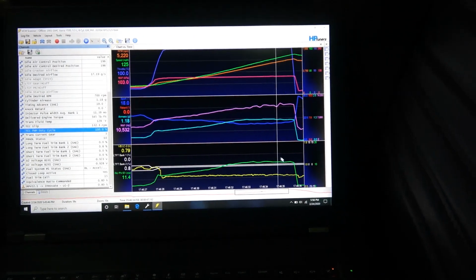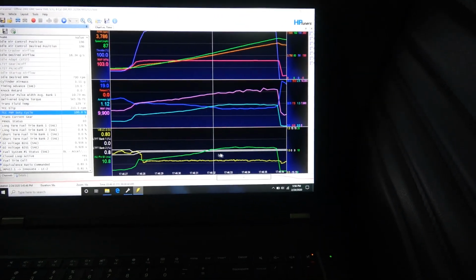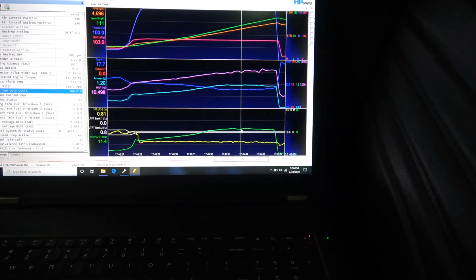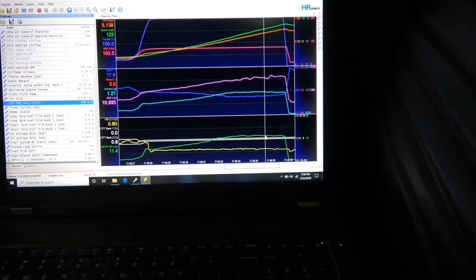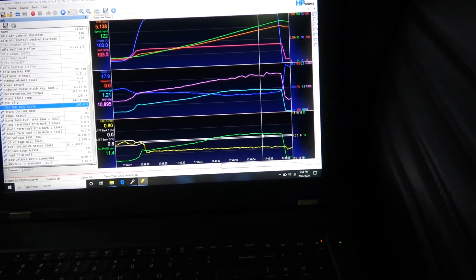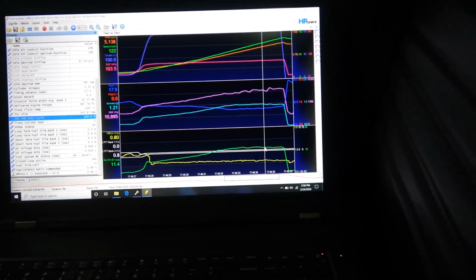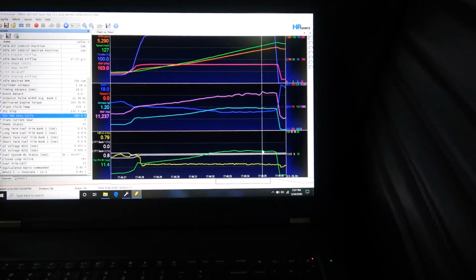So that's a pretty standard way of doing it, going back to those dynographs I showed you. As I worked the timing up a little bit, we gained another 6 wheel horsepower, something like that, and then that was it. That's all I wanted to go. I tried another degree, and it didn't do anything really. It made another 3, and that's just where you're going to leave it. So that 416 number is where we're going to be.